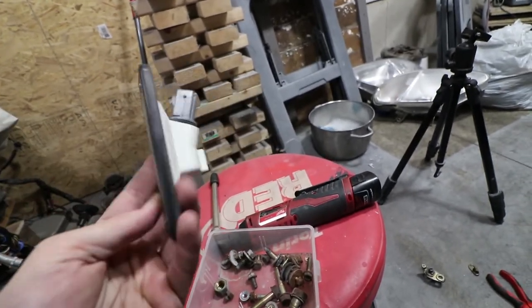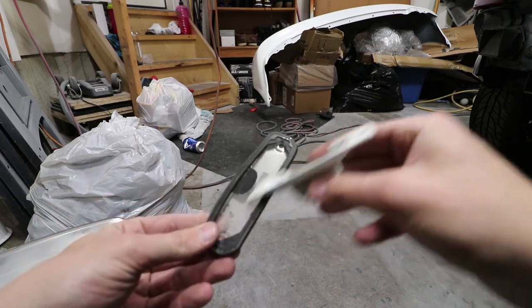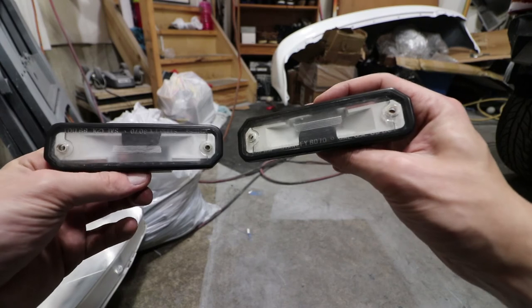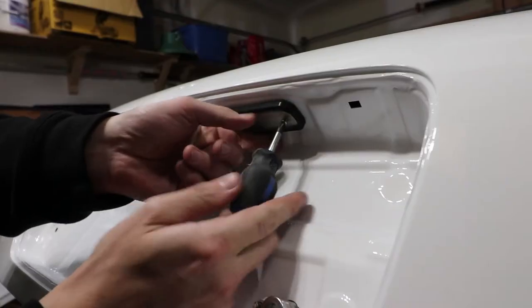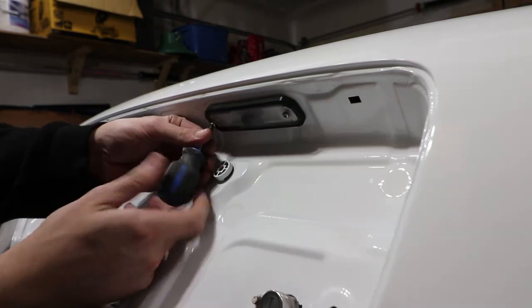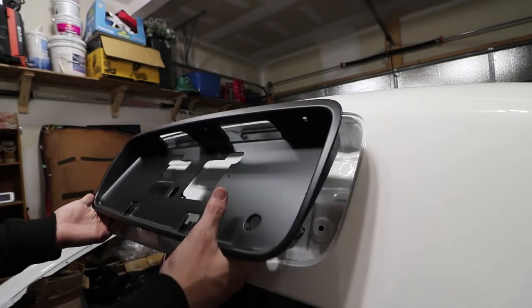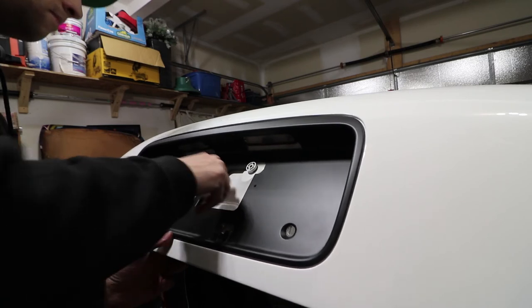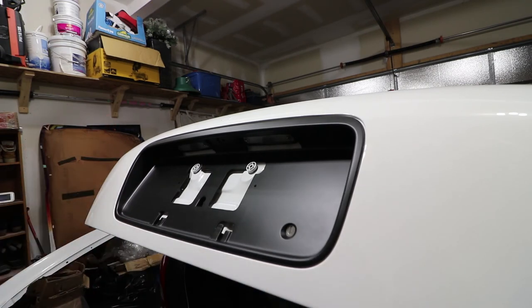As you can see there's a lot of debris inside these lights. The nice thing is you can actually take them apart and clean inside. Now that I have the light removed, I can remove that rubber seal and clean up in this area and inside as well, just to make this look a little bit cleaner. After a quick rinse in the sink, it's much cleaner and much nicer. I'm not too worried about having to clear these or anything like that, so I'm going to put them back on the car right now. Throw those screws back in, clip the cover in the center, and put those nuts back on. That's how we're looking.